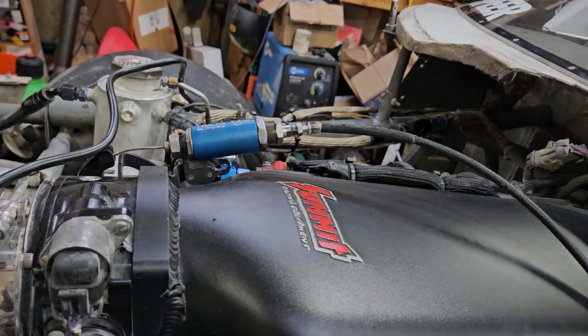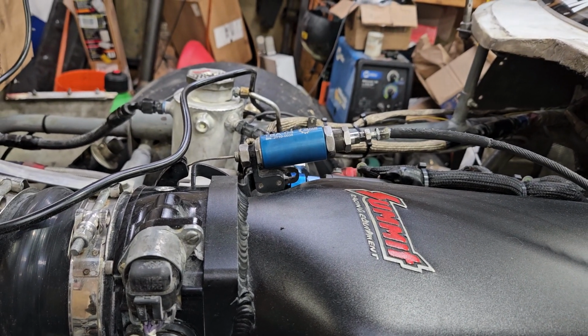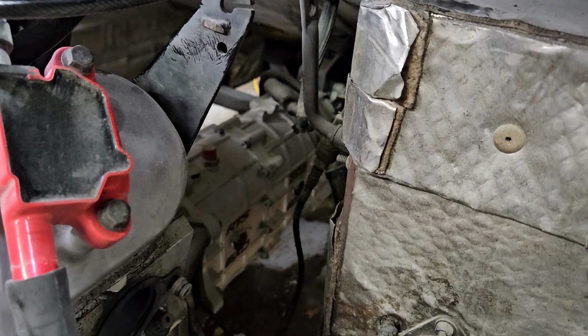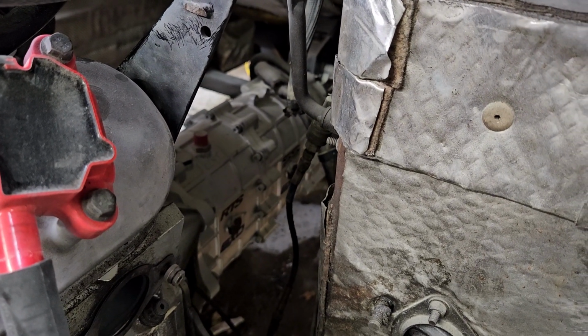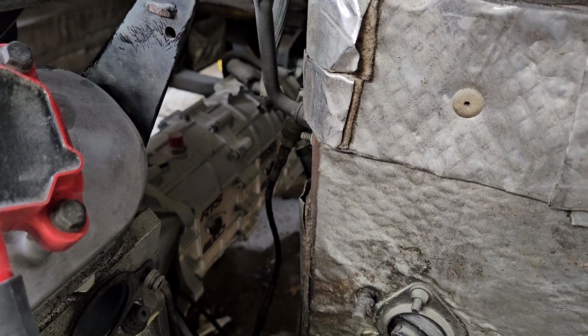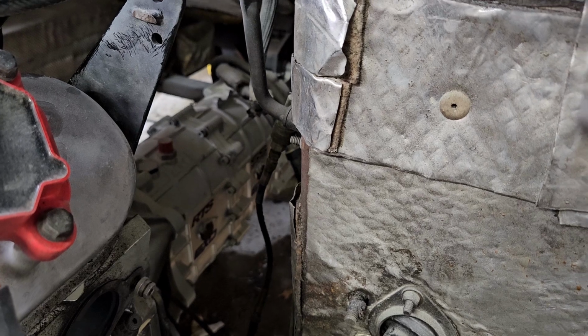The second thing that we're going to have to talk about is this little guy. That is an air cylinder tied through the throttle cable that is going to be feeding air pressure to blip the throttle for me when I'm downshifting because of this little guy hiding all the way down here. And I know that's kind of tough to see. That is a 6XD 5-speed transmission. That is a full sequential transmission that I still need to finish getting some of the plumbing done for, but it's basically all hooked up.